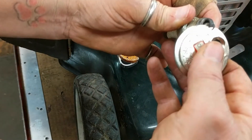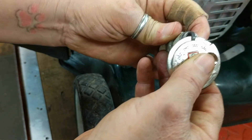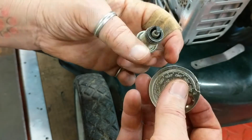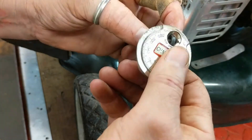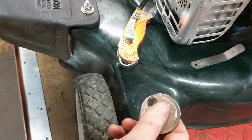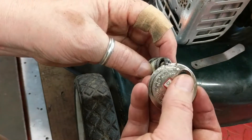The way this one works is you run it up there and see where it stops — it stops at about 0.030 inches. And if it's too tight or too small, you can push it further in to open it up. If you get it too big, you can put this end of the tool in and sort of raise up on it. If it's too big, you can tap it on a piece of wood, something like that. But anyway, this is how you gap the plug.